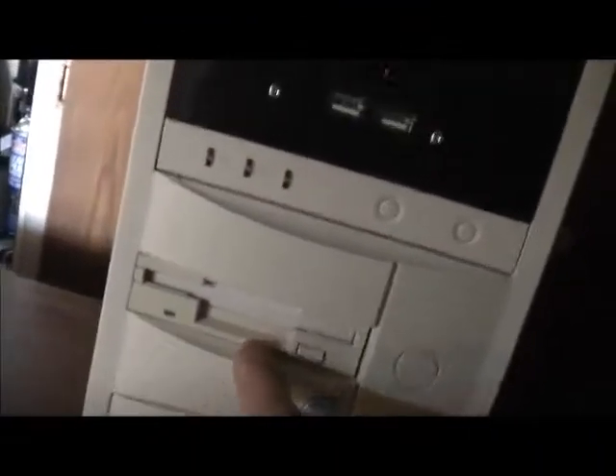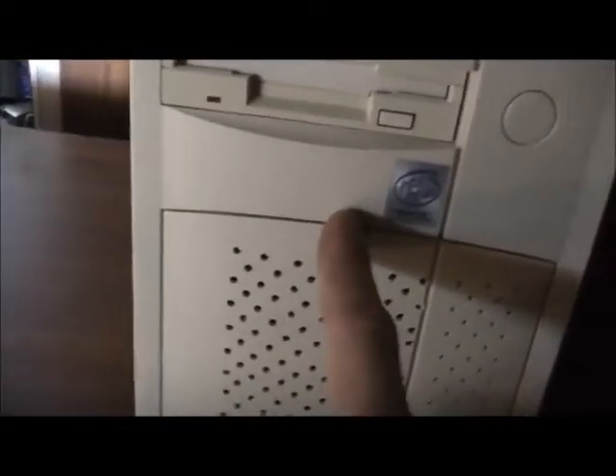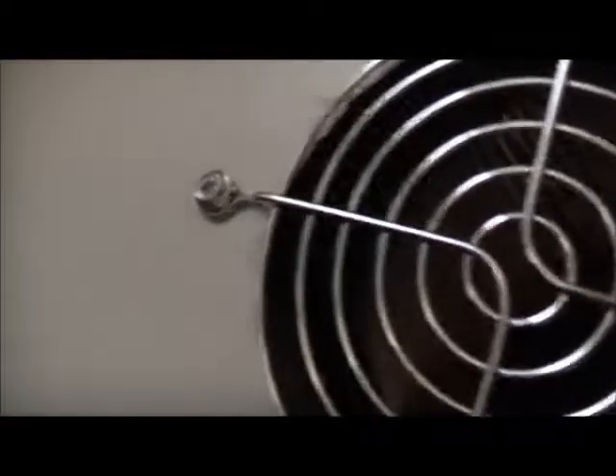I'll leave this computer on here now — it's taking up too much space. I removed all but one stick of RAM. Windows 98 seems to run on 512 meg, but unfortunately it gets to the loading screen, gets halfway through before it gets to the desktop, and hangs and freezes on the loading screen. It's a bit of a shame. I've also put the Zalman cooler in this — that helps keep the Pentium 4 cool. Without that, this thing is a bloody space heater.